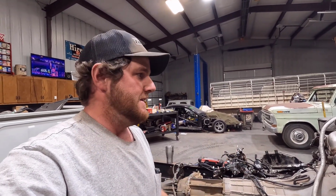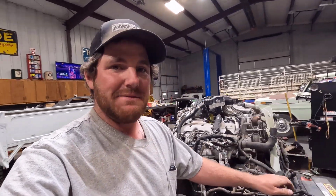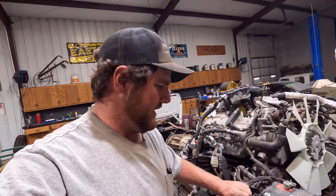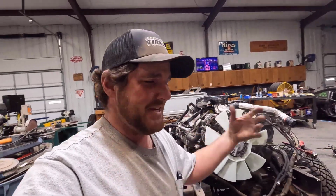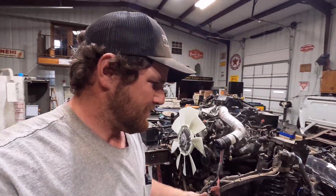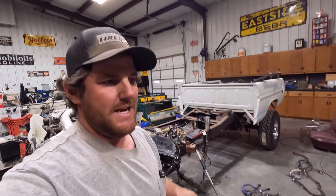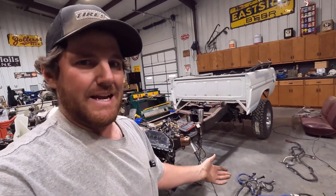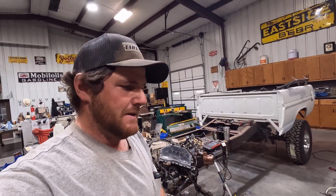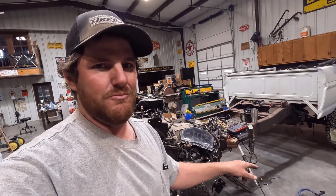I think if I had fuel to this thing, it would fire up. So that's my next step, is to get that fuel pump running. I have to yank the harness off the F450 frame. I do want to keep that circuit so it's still running off the computer, because it shuts off when it doesn't need it and that kind of stuff. So I want to keep that circuit active instead of just hot wiring that pump.